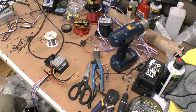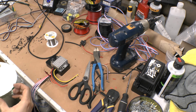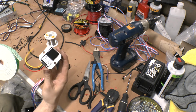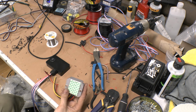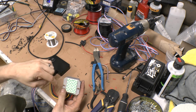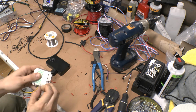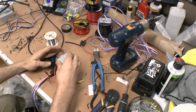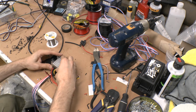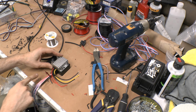So you probably got a couple different options you can do. You know, different types of two-sided tape that you can use to attach this on top. But I just use this stuff, little like Scotch 3M stuff. Seems to work pretty good. And I just line it up under the bottom side of it. So right like that. Usually takes about 2 layers because the epoxy that they put in there doesn't always come up as high. Sometimes it does. But the main thing is that you want the tape to actually be higher up than the epoxy itself. So then I will line that up basically in line with the grommet. That's one of the reasons why the grommet's offset.